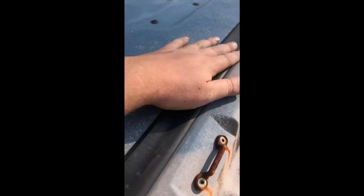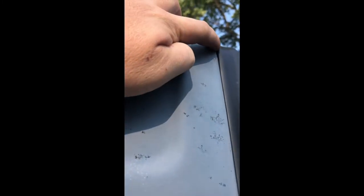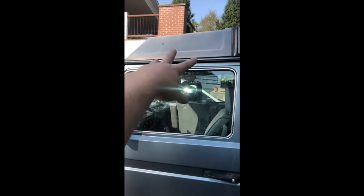I have to make some adjustments first. This top seal fits really nice up here — I'm very impressed — but on this side not so much. We've got a little bit of a gap here. The elongated bolts back there are pulled all the way forward and it's still not good. The other side is pretty good — right where we want to be. That side moved forward quite a bit, this side is already maxed. Not sure if we need to mill that out and take the whole top off, or if there's enough adjustment on the luggage rack, or if we just need to suck the whole thing down a hair more.